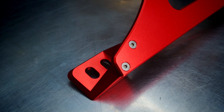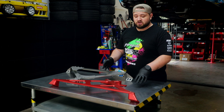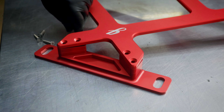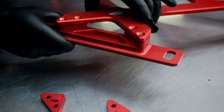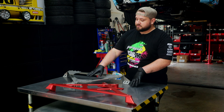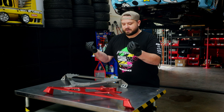It has three removable landing points, which is awesome because whenever you need to do maintenance on the car — oil change, whatever it is — you can remove that center section out just by itself and then do what you need to do, put it right back on without ever having to loosen up your front control arms or your steering rack. And then previously on E30s, you would have to run a little spacer underneath this in order to bend it down a little bit.